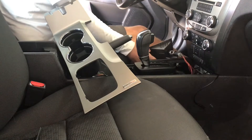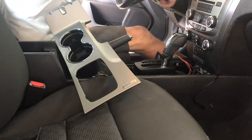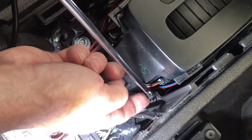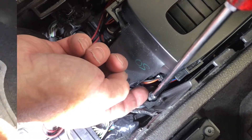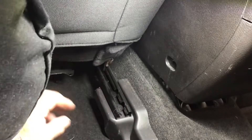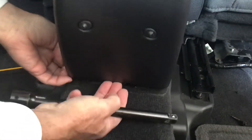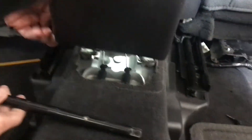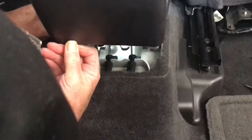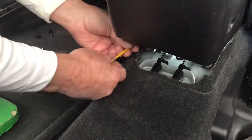The two orange wires that you see in the power point are not factory — I had installed them previously to supply power to my GPS. You need to remove six screws so that the center console can be lifted to facilitate the installation of the wire. I forgot to record the removal of these screws so I'm using some footage of installing them to give you a visual of their location. Now that all the screws are removed you can lift the back of the console up. I slipped a half inch extension underneath it but later found out a piece of 2x4 would work much better.